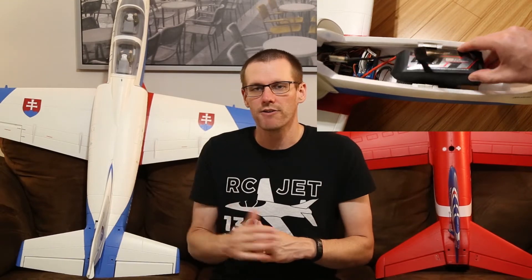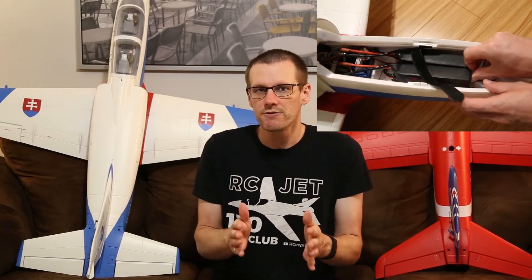The next step is to see what battery pack you can physically fit into your RC jet. I'm starting with 6S and bumping up to an 8S configuration. I needed to drop my 8S packs into the jet to check for physical room and center of gravity adjustment. Motor weight will also change, so you're balancing multiple factors. Step one: figure out the voltage you're going to run. In this setup, we're running 8S. Then we pick the speed control, motor, and a new fan unit that can handle the power.